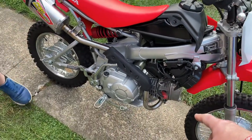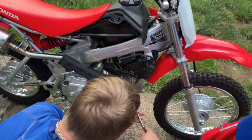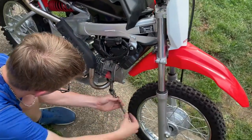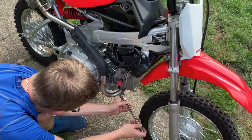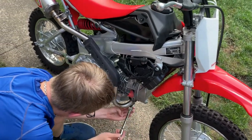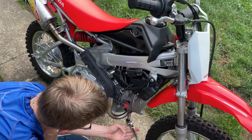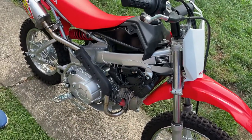You just learned something — loosen up the bolts on the head. I never tighten everything up until we're completely ready and everything's installed. I always put my bolts on hand tight so everything's still flexible and able to move around.